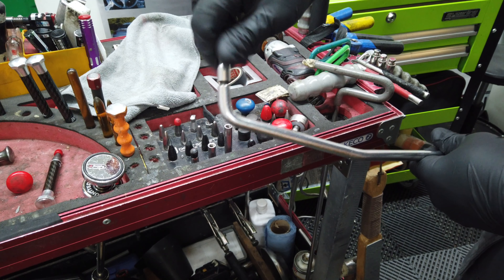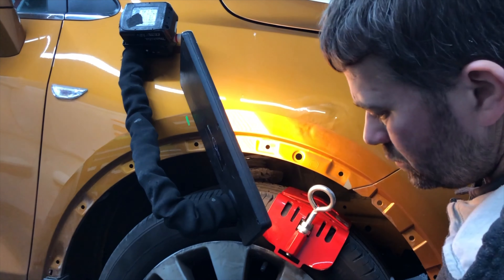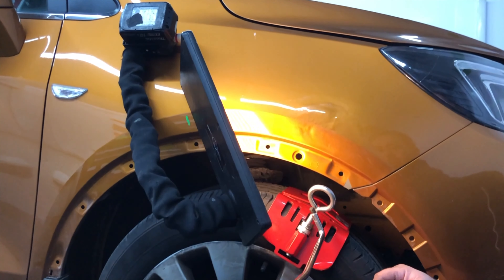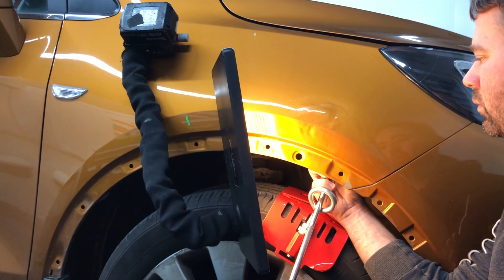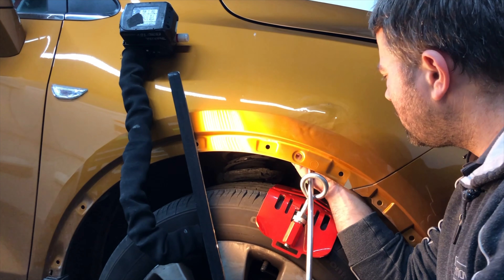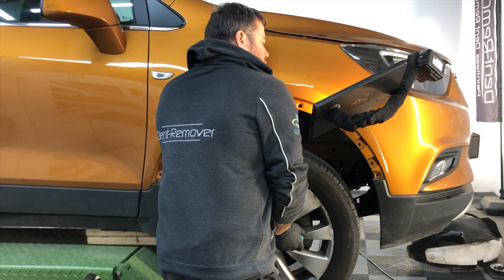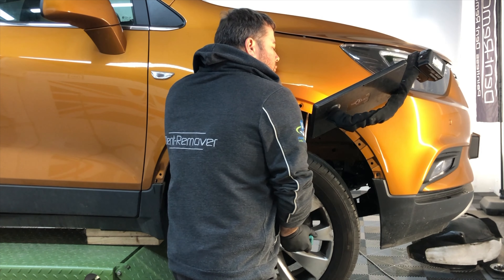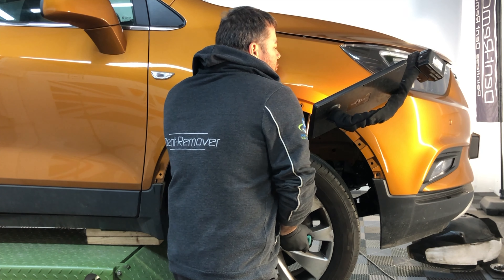Okay, so after working the crown for some time I've got it into some kind of shape, but I need to be a lot more controlled in what pushes I make. So I'm using the ultra double bend bar with a plastic bullet tip and the moose knuckle, so I can lift out all the low areas of the damage with a bit more precision. I'm nearly there now — just a few small pushes left to do.